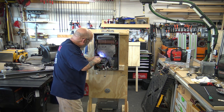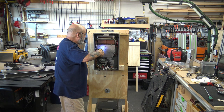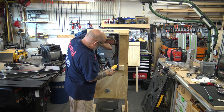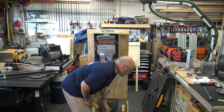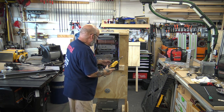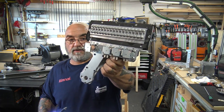There are long screws and short screws. The long screws go through the thick burner plate into the sheet metal. When you take off the burner plate, you'll see the difference. Here's the burner. Here are your solenoids — gas solenoids for low and high fire.